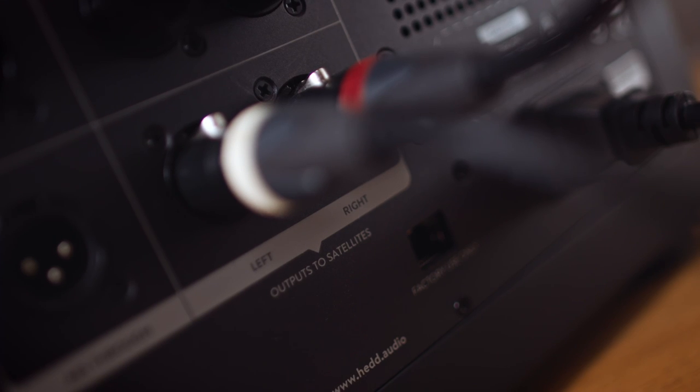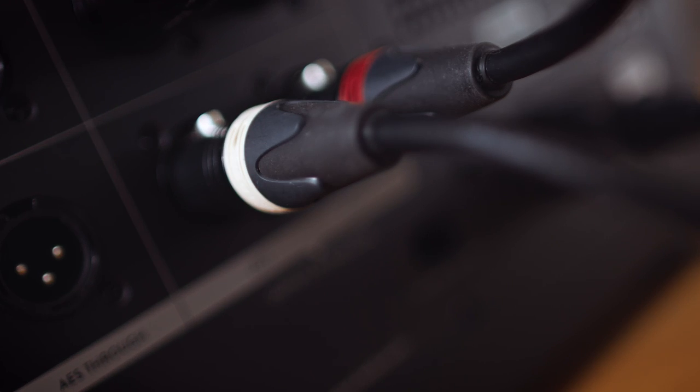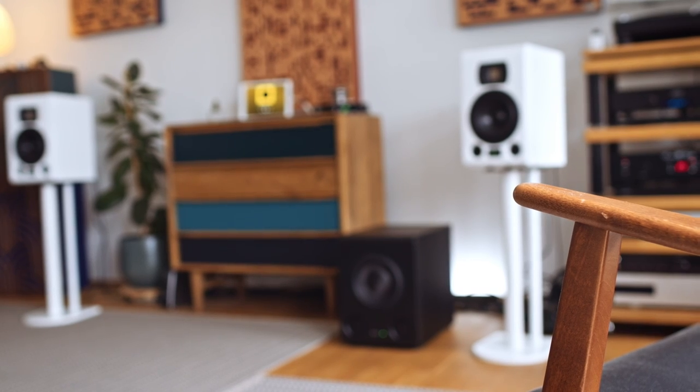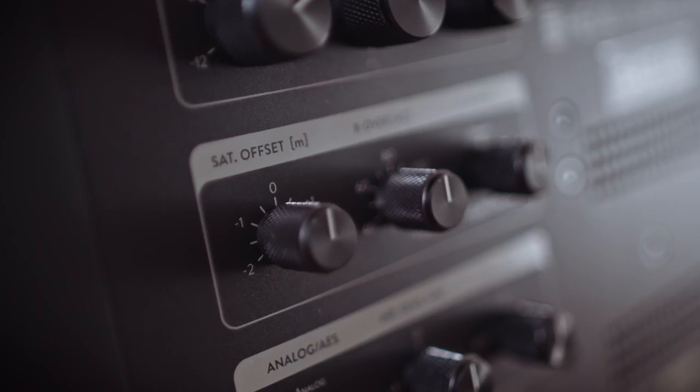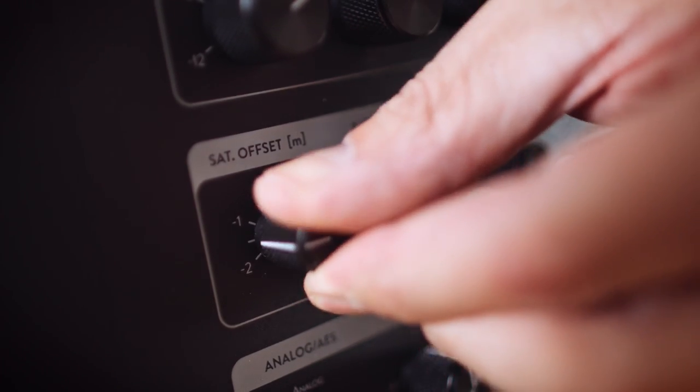So because the sub is delaying its analog outputs, the analog outputs that go to the Type 7, it means that the entire system, the complete system, sub and satellites, is 100% time aligned. That's assuming that you have the sub, as I do, on the same plane as the loudspeakers. If you can't do that, if you have to bring it further forward or further back, there is a compensation